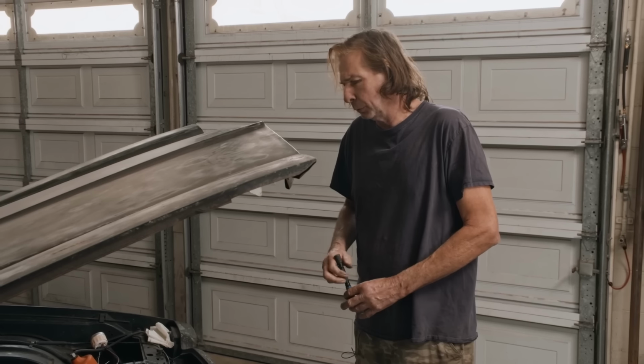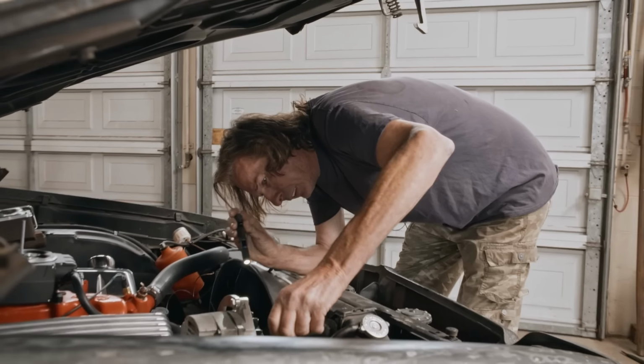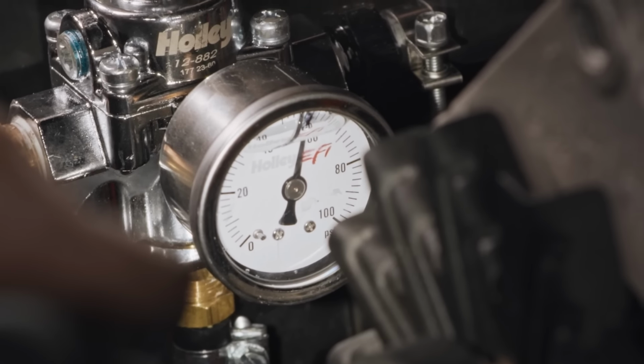And it powered on the fuel pump, as you can hear. Go ahead and hit the fuel pump and I'll see if I can set this regulator to 55 PSI. You have to do it pretty quick because the pump's only gonna run for 2.5 seconds. Okay. Ready? Yep. Nailed it. He says he nailed it. That means we can make it run. David, you wanna try starting it? First fire with throttle body injection.